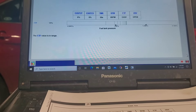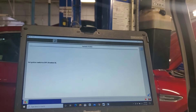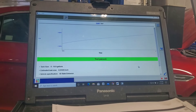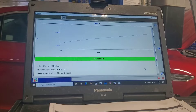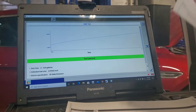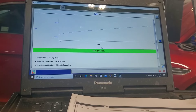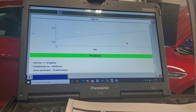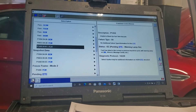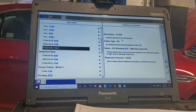It vented the pressure because it liked what it saw. Everything is in range — cycle it off, hit the check mark. Test passed. The purge valve was stuck open and it was having a hard time controlling it. Now everything's back in spec. I can go back and clear the codes. The code was P1450 — let me confirm that in the DTCs. P1450: unable to bleed up fuel tank vacuum. The purge valve was stuck open causing this failure, which is a common issue.